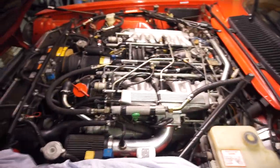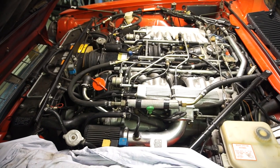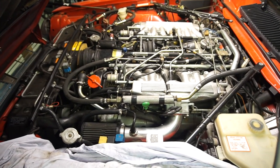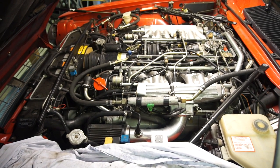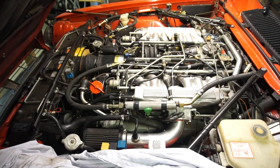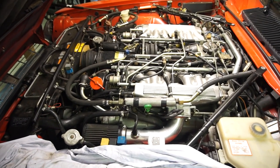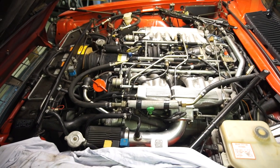Coolant is poisonous, and the odd thing is that animals really like the taste of it — it's sweet to them. They consume it and sadly they die. I live on a farm and we have cats and dogs and other animals that sometimes make their way into the workshop, and of course you don't want them to die. So when I'm done with this I can put a lid on it and move it to the side. Sometimes when I'm draining coolant just to replace a small hose and I want to reuse it because it's pretty much brand new, I can leave it in that container, pour it into bottles, and pour it back into the vehicle. Or, like in this case when I'm replacing the coolant, I pour that into the bottles my new coolant came in and bring that to my local recyclers so they can dispose of it properly. Don't just pour coolant out on the ground — it is poisonous and you might kill a little critter.